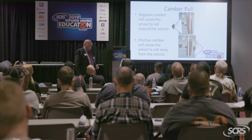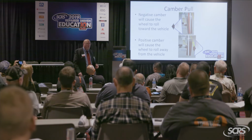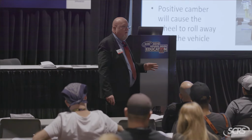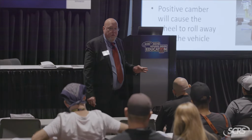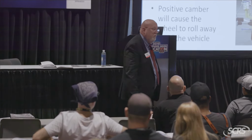Usually if the car is pulling, it's camber, caster, or a damaged tire during the course of the alignment. But if you come to our 2-day damage analysis class, which we teach all over the country and Canada, that class will teach you that there's 9 different things that cause a vehicle to pull, and we give you diagnostic flow charts for all of that as well, okay?